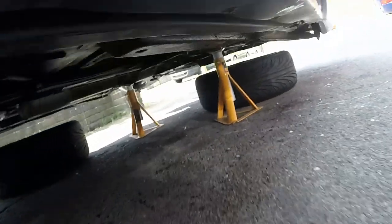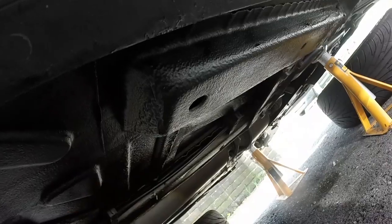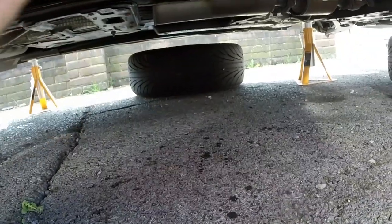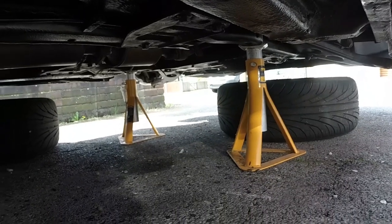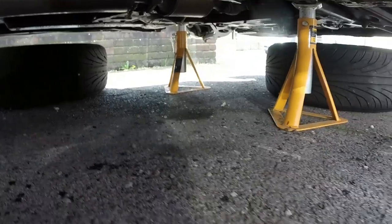I'll show you what's been done. I covered up the brakes so I didn't drip on them, and as long as you use it sparingly it doesn't go anywhere. Fuel hangers all done - you can kind of see - all the underside is done now. The vacuum hose is out and I tried to seal as much of the seals as possible. The front subframe is done. Just enough that it should hopefully stay sealed.